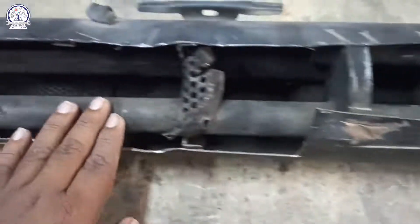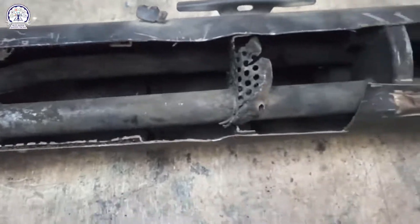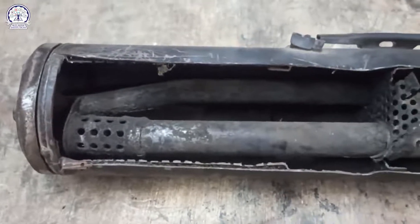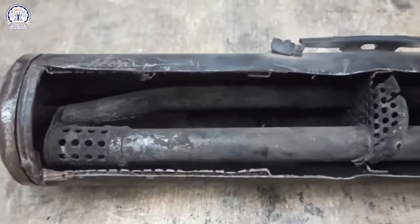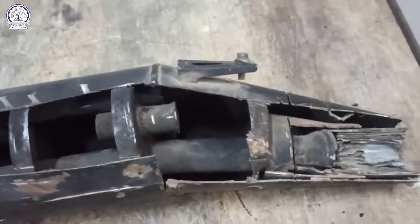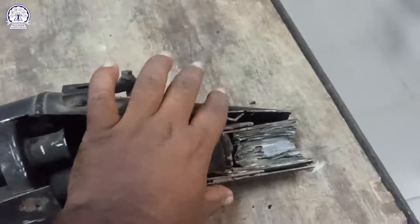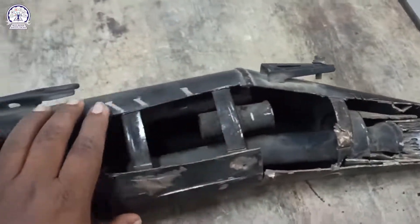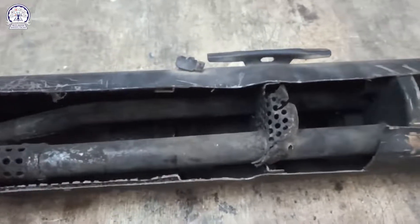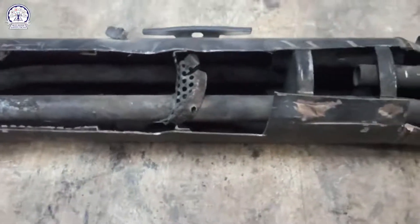Now let's come forward. You can see there are a series of pipes which are interconnected inside this silencer system. We might think that inside a silencer it is totally hollow and the air just passes through, but there is a series of piping material. If these pipes were not here, the exhaust air coming through would create more vibration and noise. So these pipe routings are made so that noise and vibration can be reduced.